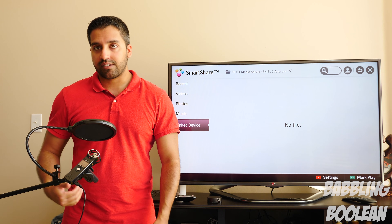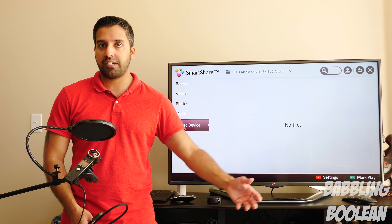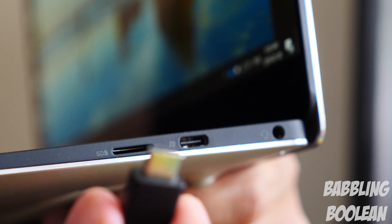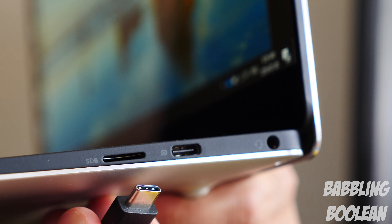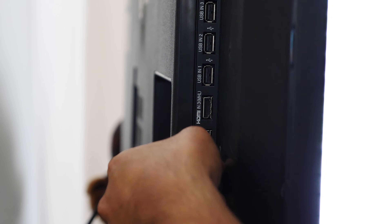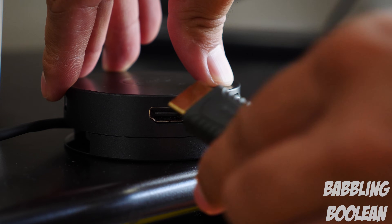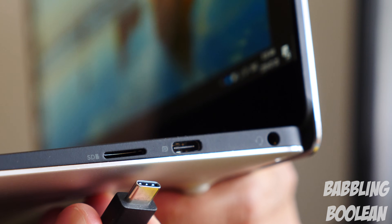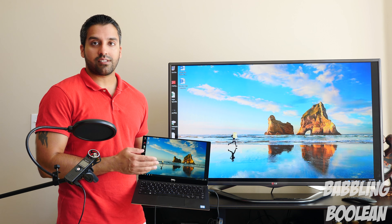You can shop around on Amazon and find lots of selection. In this example, I know the TV uses HDMI, so I have an HDMI cable, and for the laptop I have a USB-C to HDMI multi-video dongle. The HDMI cable connects to the TV, the other end connects to the dongle, and the dongle connects to the USB-C port on the laptop.